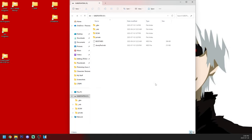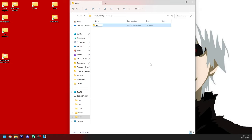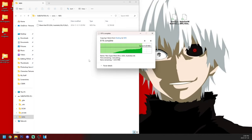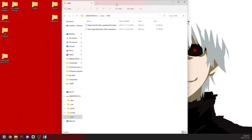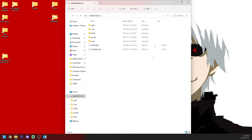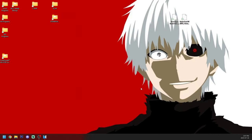Now it's time to set up our DS games to play them on our DSi without the cartridge. Right click on your SD card root, create a new folder and call it ROMs. Inside that folder, create another one called NDS — this is where we're going to place our NDS game files. So whether you get them through backing up a cartridge or other methods, as long as it's an NDS file, we are good to go. Once you have those on there, that is literally all you need to do. Eject your SD card and head back to the DSi.